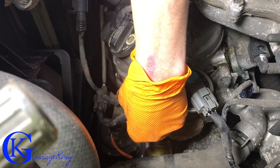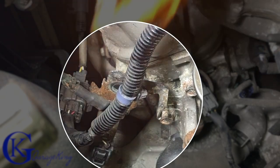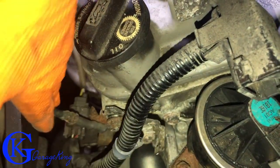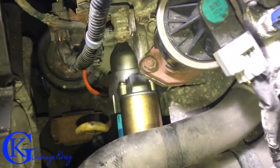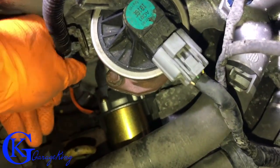Now we're going to put the wiring harness bracket back onto the side of the engine right here. There was just the one bolt that went in there — a 14 millimeter bolt, just like so. You can see the bolt right there and everything is held on by that 14 millimeter bolt. Now that our starter is installed and our wires are back on, this clip here just goes back into its clip just like so. There we go, just like that.